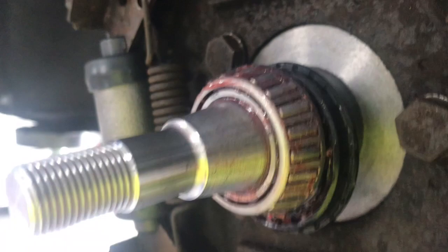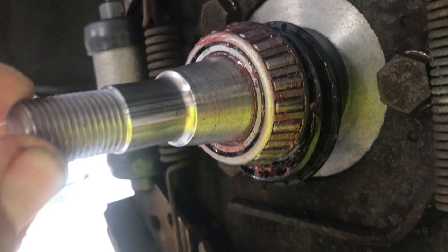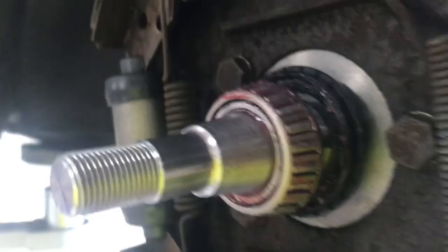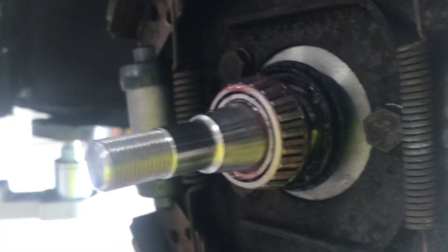This is not a good sign. I went to put the brake drum on and it didn't seem to want to go on over the spindle very well. These are brand new bearings — the other side went on fine. I pushed it on and it seemed okay, but when I went to put the outer bearing in, it did not even want to go over the shaft. I pulled the drum off and now I have the bearing stuck on the shaft with the seal sitting there. Now we've got to decide — has this been improperly machined?